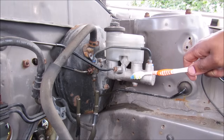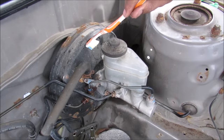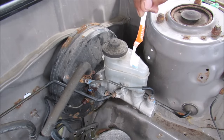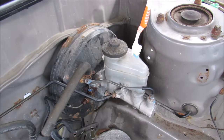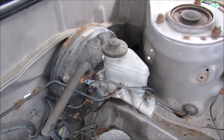Today I'm going to show you what's inside of a brake master cylinder and booster and how it works to stop your car. The brake booster is responsible for multiplying the force from the brake pedal onto the brake master cylinder. In the brake master cylinder there are two pistons that push hydraulic fluid from the reservoir through these lines and then out to the calipers to stop the car.